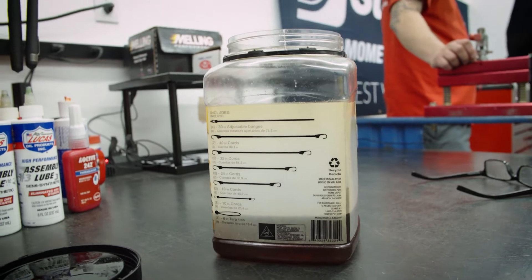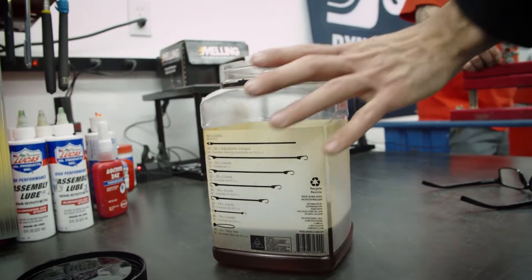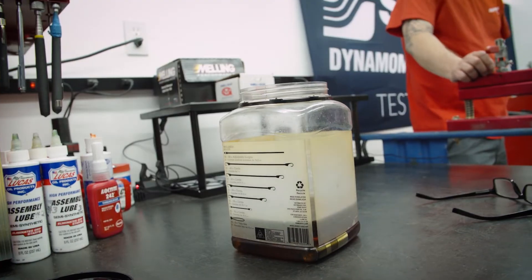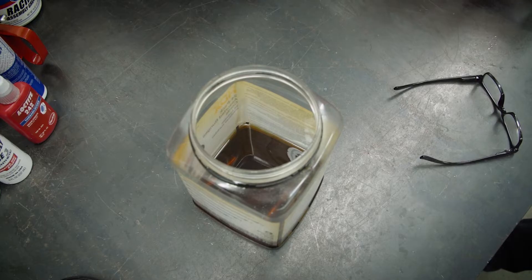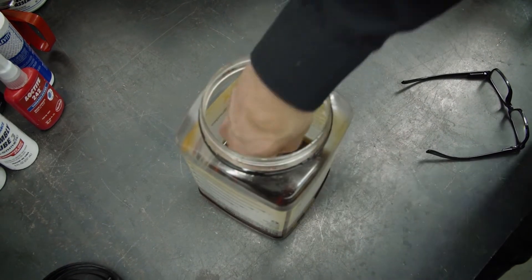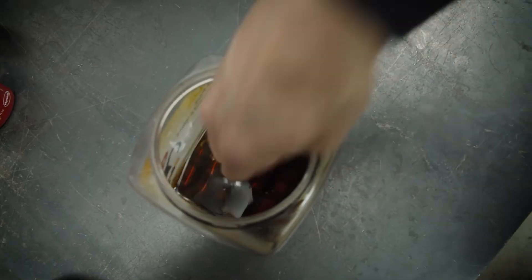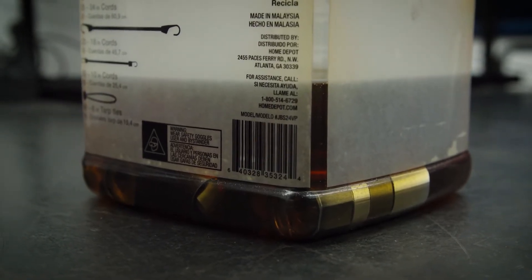What I like to do is soak these in oil. We just have standard motor oil in here — I think it's actually break-in oil — and we just drop them in. You just want to get oil into all the nooks and crannies of these lifters, everywhere. That plunger inside needs to fill up with oil, so we're just dropping them in. That ensures that everything in there is getting full of oil — a little pre-lube process. Exactly.